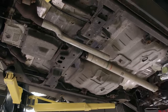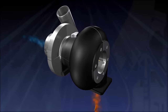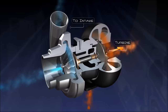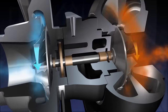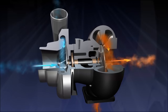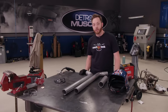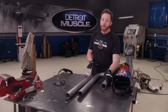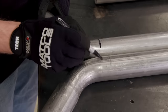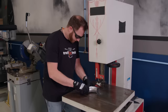I think we're off to the races. Now we're talking hot side and cold side when it comes to turbocharging. Turbochargers are forced induction devices that use exhaust energy to cram more air into an engine. Exhaust flow from a header drives the blades of a turbine wheel before it discharges. On the other side, an aluminum impeller wheel draws in and compresses fresh air. These wheels ride on a close-tolerance shaft that can spin well over 100,000 RPM. Race motor turbos can easily increase intake pressure by as much as 50 pounds. Because we're running a single turbocharger on a V8 application, we've got to get exhaust from both banks into a single two-and-a-half inch pipe. You can buy a Y-pipe off the shelf, but this is a budget build so we're going to make our own, starting with two 45-degree bends cut after the radius, then joined together so a two-and-a-half inch pipe connects right on the end. There you go — you've got your own Y-pipe.